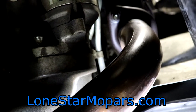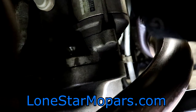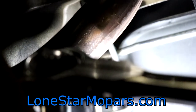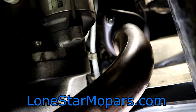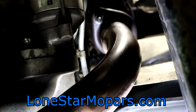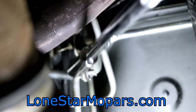This is just something I cannot do on film — I'm one guy, I've got two hands, that's my limitation. We are on the driver's side. There's the starter. If you tilt back up you can see that oval flange right there where my finger's covering — that is the nut on the bottom side. We've got the same thing down there that you can't see. This has gone surprisingly smooth. I've got a half-inch swivel head ratchet, a real long extension, and a 14 millimeter socket. I broke one free on the passenger side — not broken, but freed it surprisingly. There's like a clip on the top that keeps the bolt from turning when you go at the nut on the bottom side. I'm hoping that's a feature on all four of them.